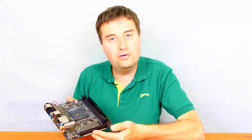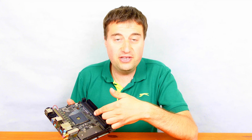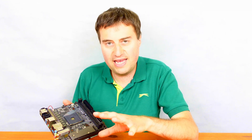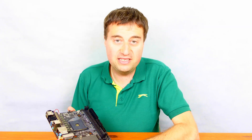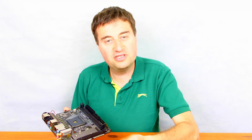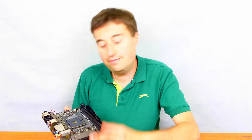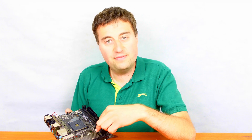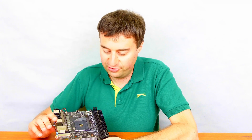Coming to the bottom of the board we have a PCIe Gen 4 x16 slot, which is nice. If you have a Gen 4 compatible CPU you can use that, though if you're doing an APU build the 5600G and 5700G unfortunately only support PCIe Gen 3. You can fit a normal full-size graphics card in, giving you flexibility for a full gaming PC. There's also one M.2 slot — perfectly fine for an NVMe drive, and you can fit at least a 2TB drive, maybe even a 4TB.